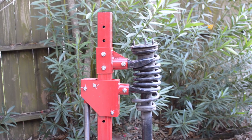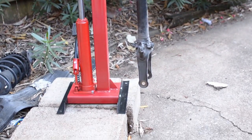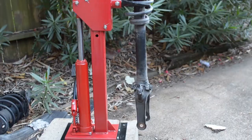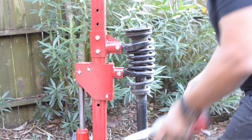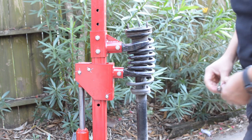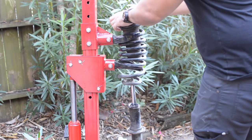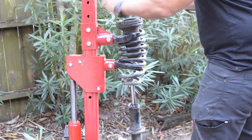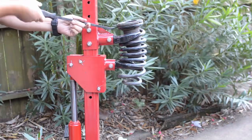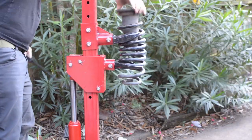I placed the spring compressor outside my garage over concrete blocks — I needed the height because the strut is pretty lengthy. The struts are already in place and the springs are already compressed. Remove the nut that secures the strut to the strut mount — the strut is now off its position. Next I'm going to remove the strut mount, then move the strut out of the way, and use a pry bar to remove the rubber mount out of the spring coil. Notice the spring compressor height securing the spring coil safely.